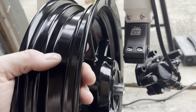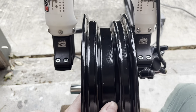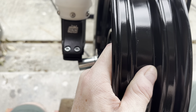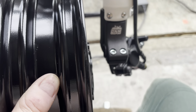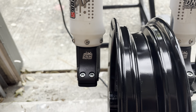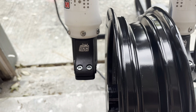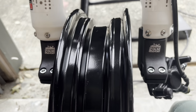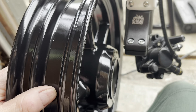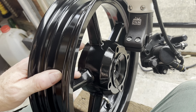Back again with the wheel and the spacers from the stock bike inserted. When we look at the alignment, it doesn't fit — spacers are too long on both sides. The good news is we can shorten them, have someone cut them to fit, or use the stock spacers that came with the wheels from SV Racing Parts. I'm going to try that option and see how it works out.